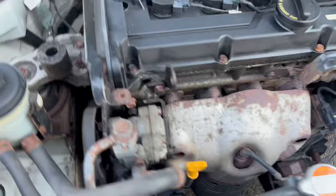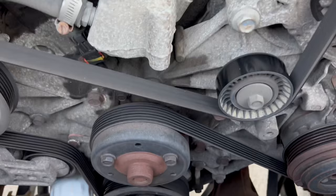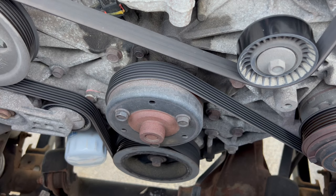Also come around and look at your heater core hoses. Mine are down here and they're not leaking. Find out where your water pump is and check that too. Here's my Jeep — on the water pump in the front, usually underneath, if it lets go there'll be a weep hole and it'll leak a little bit from there. That's typically how you know when a water pump needs to be replaced.